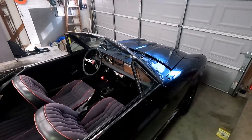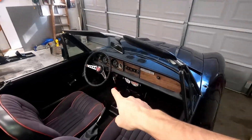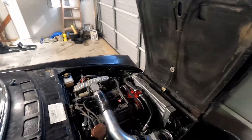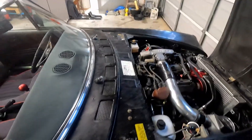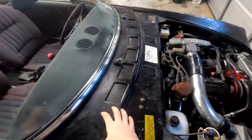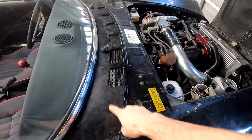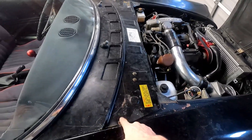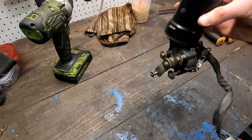Just real quick before we jump in, if you guys do not know how to remove your wiper motor, I'm going to show you really quick. All I have to do is pop the hood, lift this here, get it propped up, and you remove some screws all on the front here. This whole cowl will remove and the wiper motor sits right here. You just flip it upside down. There are three 10 millimeter bolts that detach it from that point here, and unplug it from the wires right underneath here, and you bring it over to the bench, and this is what you'll have.